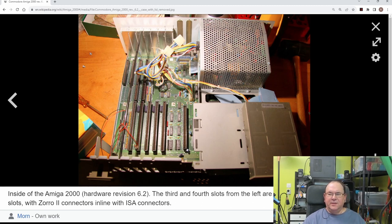When it comes to upgrading, you could go nuts with this thing. With the bridge board concept, you could go 286, 386, 486 for PCs — you could get up to the 486 level. I think there was even a so-called Pentium model, but I can't be sure. For the Motorola CPUs, you could swap in a 68010 directly on the motherboard itself, and then via expansion cards you could go 68020, 68030, 68040, and 68060 — many different CPU upgrade options.